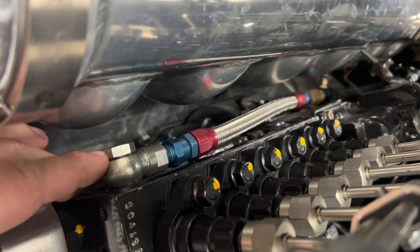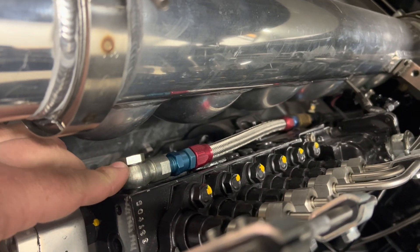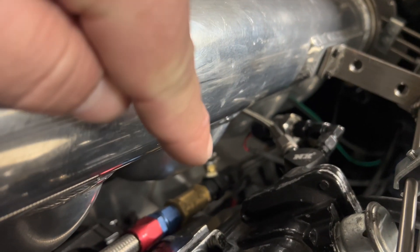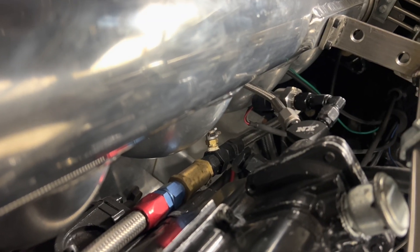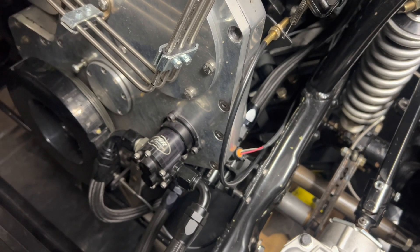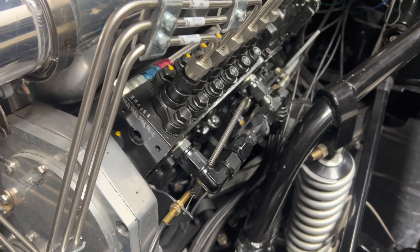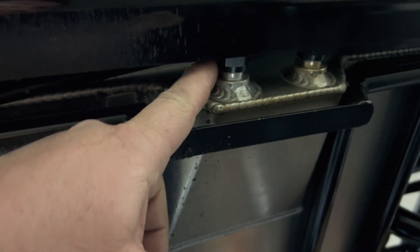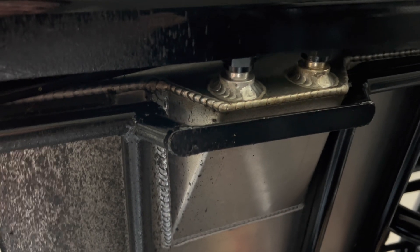As far as fuel pressure regulation goes, that's all done on the overflow valve side. Basically this is a high speed check ball back there, and this overflow valve is just wide open — it's being regulated by the check ball. The injector return just tees in to where that little brass fitting is, and then that dash 6 line goes back to the tank. This setup is dependent on RPM of course because it's mechanical, but it'll make 10 to 15 PSI at idle, and down track I'll see about 80 PSI of fuel pressure, which is good for keeping the injectors nice and happy. Same deal on the fuel return — fuel feeds over here, fuel returns over here, returning to the tank, just like the common rail setup.